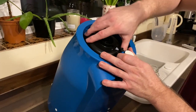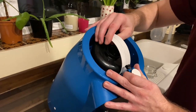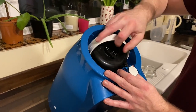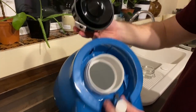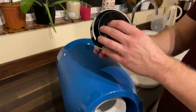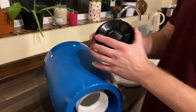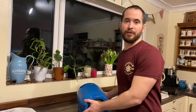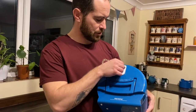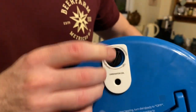Now this will be done all the way up to the top normally, and it can be quite stiff when you first undo it. But persevere, you won't break it. Anti-clockwise, and then you pop it off. Inside you'll find there's a small conical piece — it's crucial to make sure that is still attached when you connect it all back up again, so I would advise leaving it in there. Now when purifying and sanitizing, they ask you to make sure that the dial is moved onto carbonated. Double check that that's on carbonated before you start — mine is.